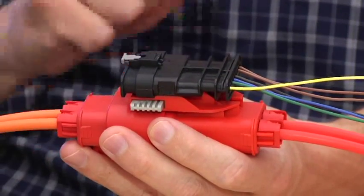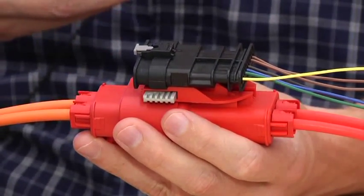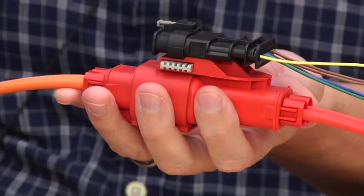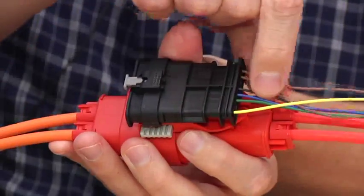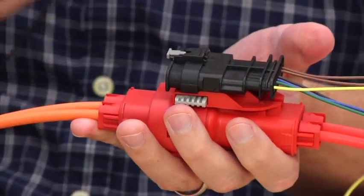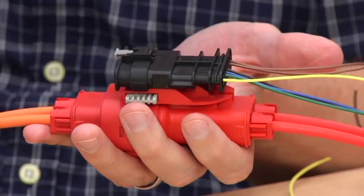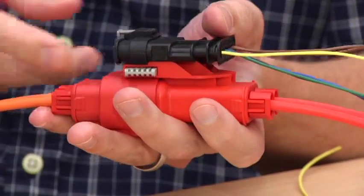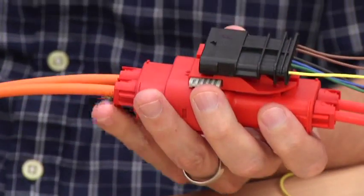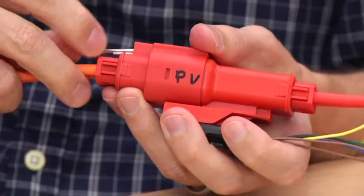The air conditioning compressor is one of them, and that's what this was designed for. In a lot of these electrified vehicles, there is a high-voltage interlock loop circuit. What you see on top, piggyback to this connector, is a low-voltage connector which has a loop circuit in it. In this older style of connector, to make sure that you disconnect it safely and that the high-voltage interlock loop was broken first to signal the battery to shut down and open up its contactors, you would have to unmate this connector, which would signal the battery to shut down, and go through multiple additional steps including pressing a switch and then getting a tool and unlocking the connector.